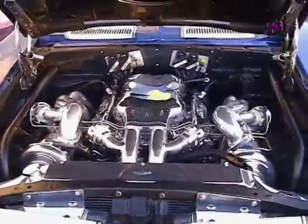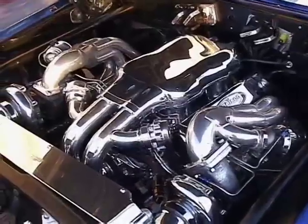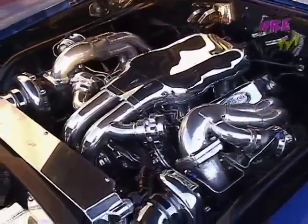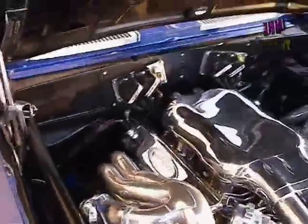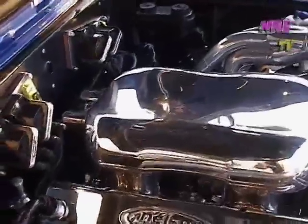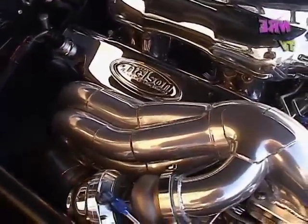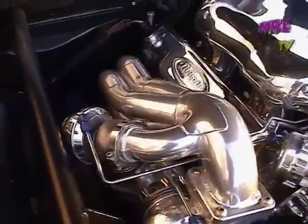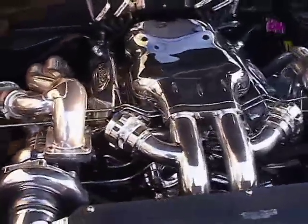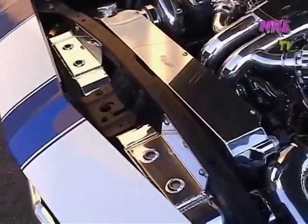Take a look under the hood — it's got one of our new 427 small block crate engines with billet intake, twin injector per cylinder, twin fuel tanks, octane on demand, all the fuel regulators built in the back right there, internally boost referenced, billet valve covers. Nelson Racing are some of our 321 stainless headers, with v-band 44 millimeter wastegates, all hard line, dual blow-off valves, and it's twin intercooled.